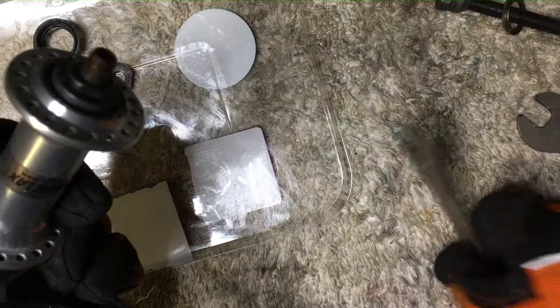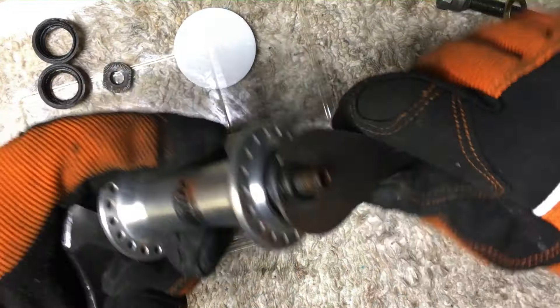And then I'll find two lock nuts the same length so that, again, it's uniform. Then we'll see how much slack I'll have to fill in inside of this fork. I should mention that this fork is 120 millimeters spaced, and a front fork should really — especially an older one — only be spaced 100 millimeters, which is why front hubs are spaced 100 millimeters, and which is why I need to swap out the axle to something longer.